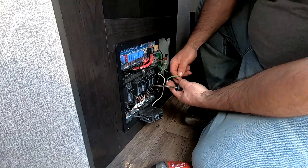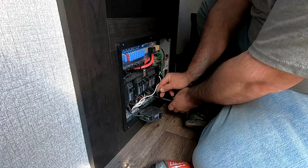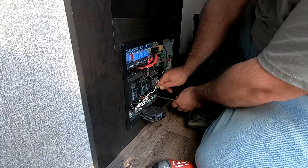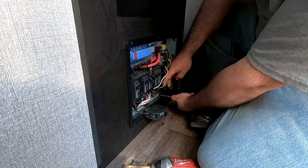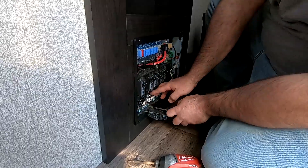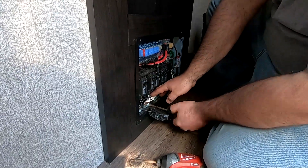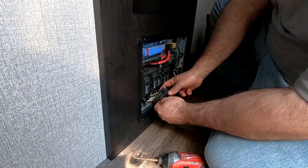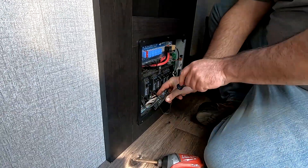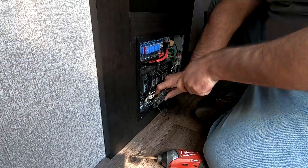When changing these batteries over, make sure you turn off all your inverters and make sure the RV is completely unplugged from shore power — there is no way you want any of that power coming backwards and getting you in a bad situation. When nothing is connected, make sure you install the converter or your battery charger before anything else gets connected. The reason we're installing this new battery charger is because it has a lithium algorithm for charging the battery.